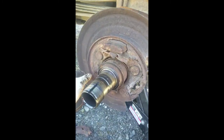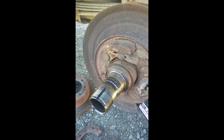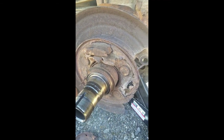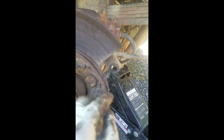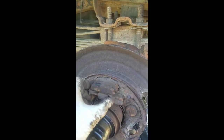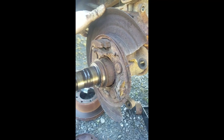I figured I'd chime back in and let you guys know a few things. First, it's easier on these retaining pins if you just push in with needle-nose pliers, turn it from the outside, and the hat will just pop off. Second, make sure you keep your fingers clear of these springs — wear safety glasses to keep from getting hit in the eye with rust or anything, because I've been to the doctor with a scratched cornea and it's not fun. That definitely taught me a lesson about being lazy and not putting on glasses. Here you can see what's left of the backing plate.